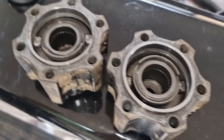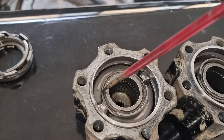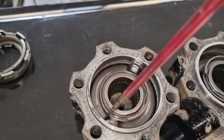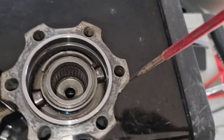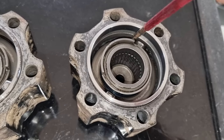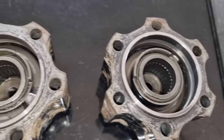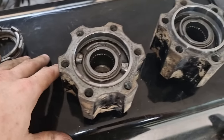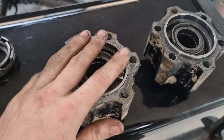There you go. I'll show you the difference: this one is sitting in the auto position on the dial and you can see it moves freely. This one here is sitting in the lock position — and that's all it moves. So this one is technically locked. We can re-grease these and throw them straight back in the car and we'll have manual locking hubs.